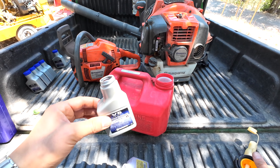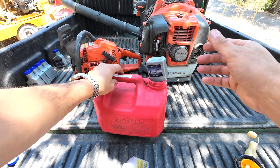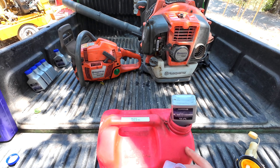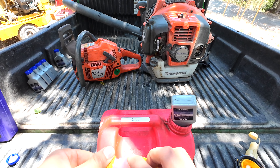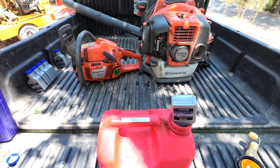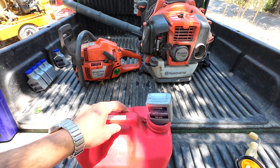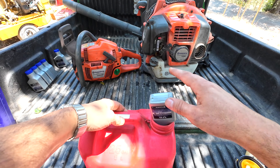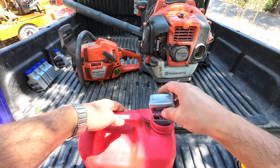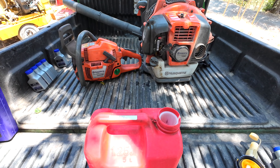In this case I need to make a batch right now. I take this container — it has 2.6 ounces of oil — and pour it right in. You always want to put the oil in first, because you want to make sure you actually have oil. If you put the gas in first, then look for oil and find you have none, you might go to the store, get distracted, come back and think the mixture is ready. That's how you burn an engine or two. So always put the oil in first. If you run your engine with gasoline only, you have about a minute before it blows up on you.